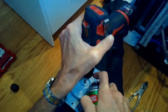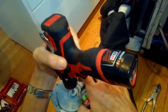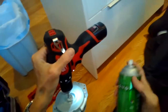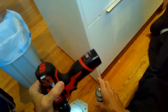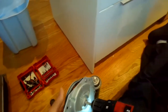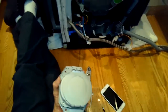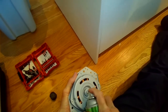It would depend on how badly rusted the bearing might be. If it's been making the squealing sound for some time, it may be smartest just to get another motor because they're not that expensive. I'm putting the white lithium grease on and spinning the shaft using my drill to work that stuff in — I'd put it in on both the top bearing and the bottom bearing. Then I'm taking the plate off the bottom of the motor to expose the lower bearing and spraying grease in there too.